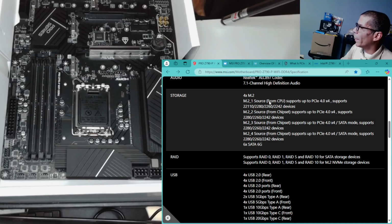this M2 slot is designated to have a higher throughput, a higher hierarchy of how fast it can access the processor, or how many times it can access the processor based on time slots. So that kind of hierarchy. That's why that one is designated for the CPU, because technically speaking, you're going to be using that as your operating system, not as your long-term storage. So that particular one is going to be as close as possible, able to request more time from the processor, and obviously the memory. So it's going to be slotted as having a higher hierarchy than the rest of the other